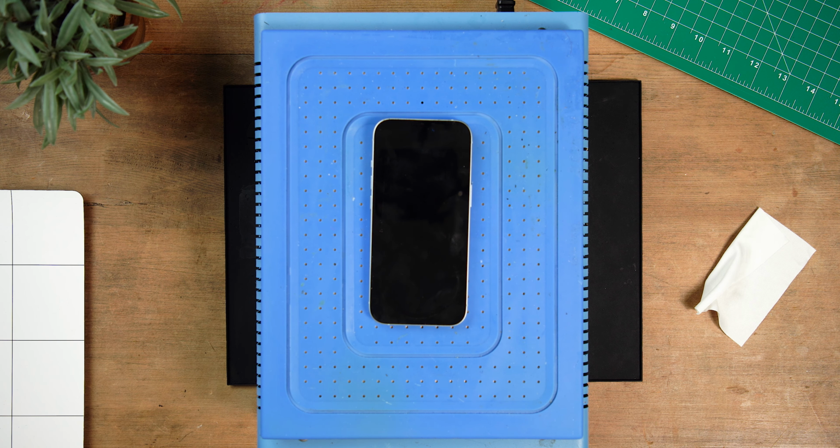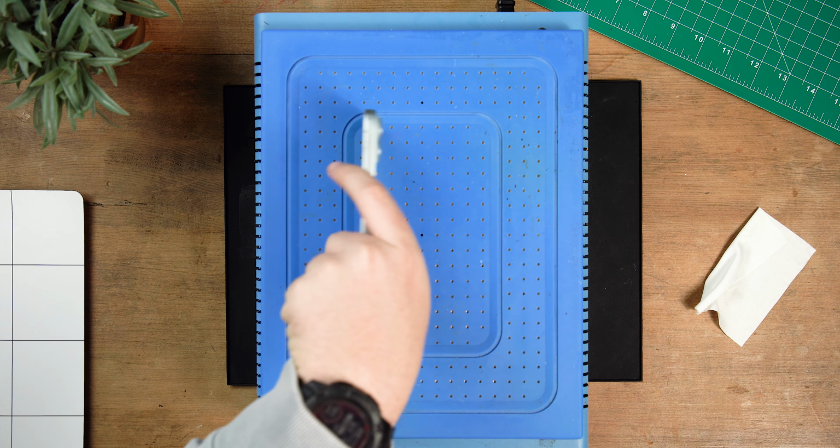It's worth noting that this isn't necessarily essential and you can replace the screen without disconnecting the battery, but we would personally recommend not skipping this step, as doing so prevents any live voltage from the battery shorting components during the screen replacement. However, if you choose to skip this step and move straight to removing the screen, we'd recommend to be especially careful not to use any metal prying tools or touch any exposed contacts in your phone.